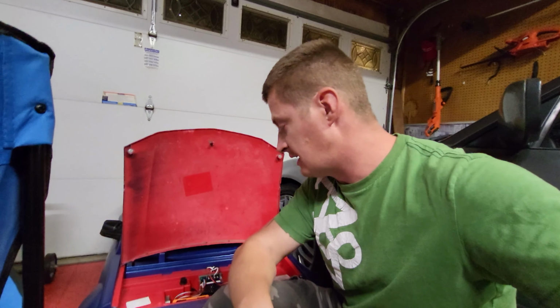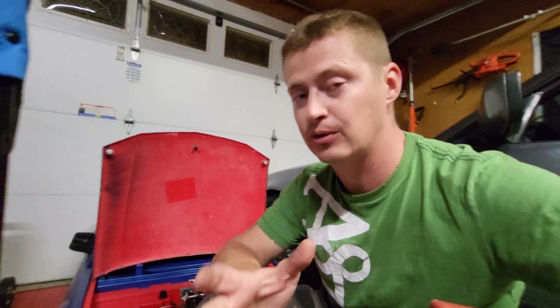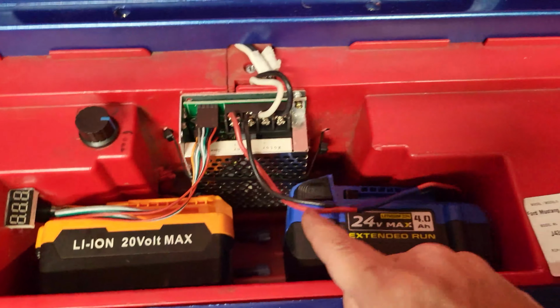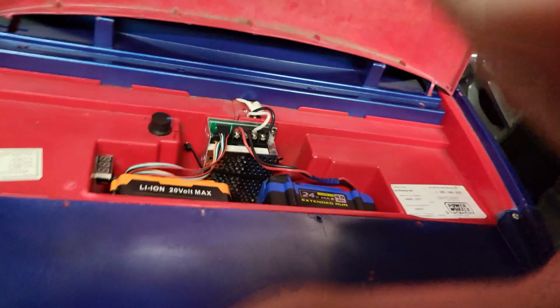So our Mustang, after going through basically 4 engines, 2 gearboxes, 2 shifters, wiring, and the accelerator pedal, I decided that's it. That's it for pure 24 volts, and I had to control that somehow. This is the digital controller that we have. What this allows me to do is run a 24 volt battery into the system by limiting the output of that battery.